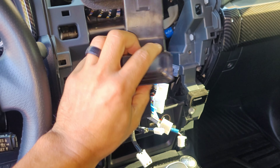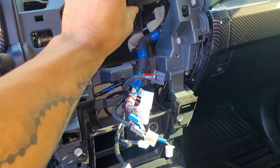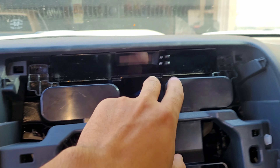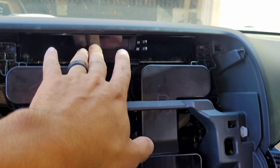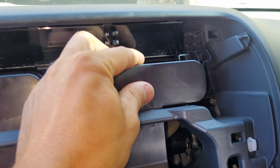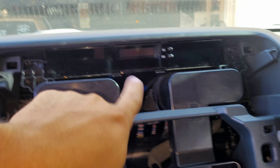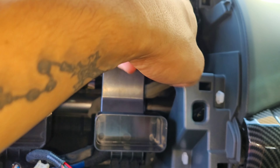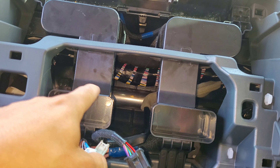Put the foam in there and start placing and screwing everything down. Leave the bottom screw for now since you'll be maneuvering things and you don't want it ripping off. What I found easier: once it's placed in position, slide the clock back and then put the second air vent relocation piece in. Some people take it off fully and try to slide it in, but there's not a lot of wiggle room. I installed this first, slid the clock back, then worked it out. This hole needs to be enlarged a bit for the bolt to go back in.